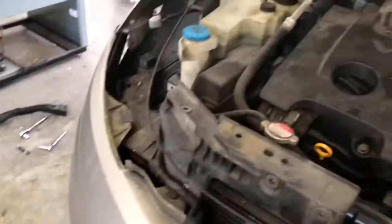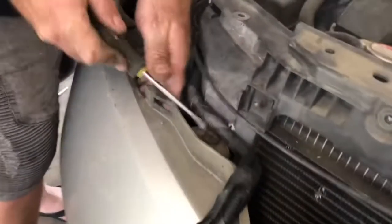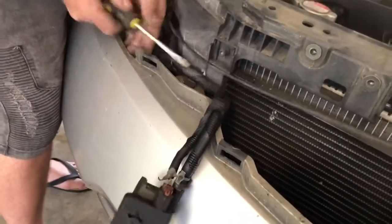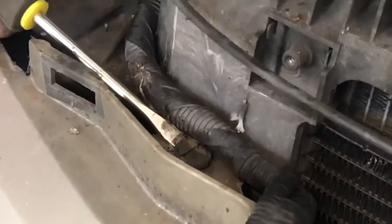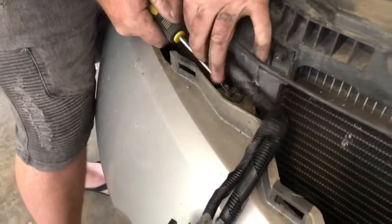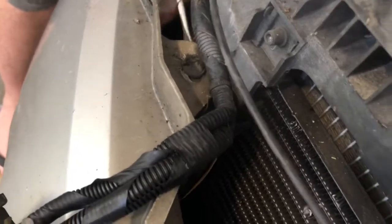So there are those two lights off. The bumper's pulled forward except for this clip in here. These are those notoriously crappy Japanese-style clips that are kind of a one-time use thing. You end up beating the crap out of them to get them out and then you end up just using zip ties. At least that's what I do — and then next time you just snip the zip tie.